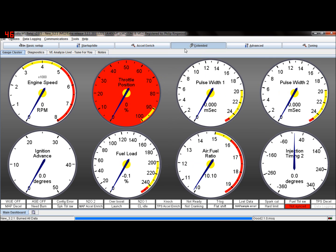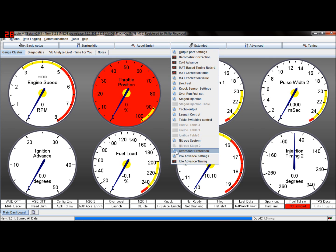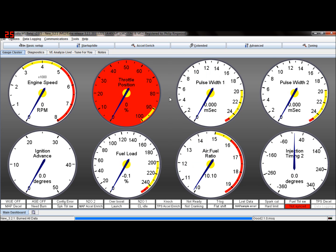The next one that's coming is going to have a lovely feature in it, especially for Rover V8 users, or anyone who's struggling with their idle speed. Keep and maintain idle speed when in map mode. It's a lovely feature coming where the ignition advance can increase and decrease the engine speed, and I've got that on mine as an MS3, and that's really good. So anyway.